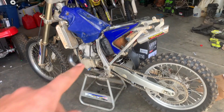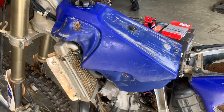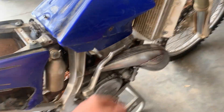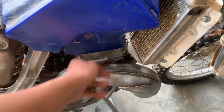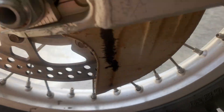Back at it with the YZ250 today. We got a couple new parts, and I got it running a lot better. This air screw was way too screwed in — it wasn't good for the motor, so she didn't want to idle. I think somebody thought that was the idle screw. Bike's pretty solid. You can see all these spokes that are missing — I don't even think it's worth throwing new spokes in.